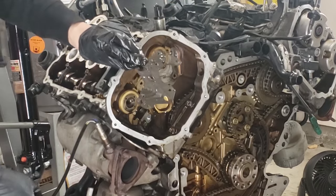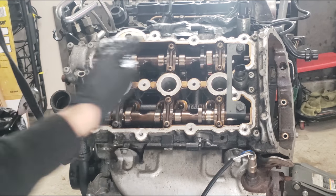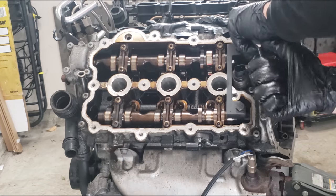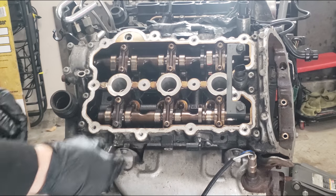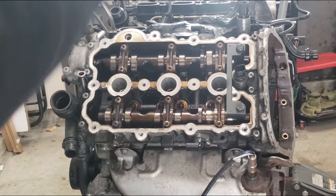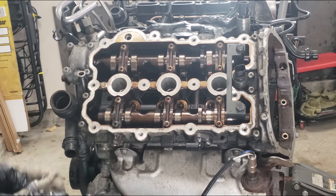Remember when using the lockout tool from the other side, you've got to switch the prongs over. Doing this outside the car was actually so much easier — I'd prefer to do it that way if it didn't involve all that extra work. When you're flipping it to this side, you've got to reverse the pins so you don't open it up when you're using it. We're removing the cam adjusters and the bolts, getting those out of the way. Then once you get to the point of removing this timing chain and the tensioner, we'll break all the bolts free, and then the chain I just take all the way out after I get the tensioner unbolted. You can see this whole piece was ready to break off and fall in there at any given time.